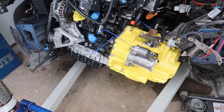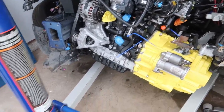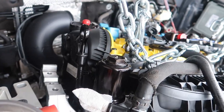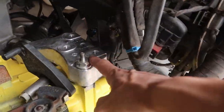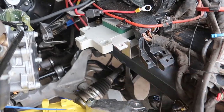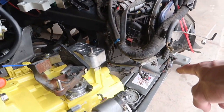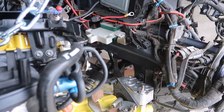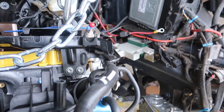This is gonna be interesting to do by myself, but basically she's in there, wants to rotate, whatever. I'm gonna get this mount, because it's gotta be under here. I'm gonna get it under there and give it a couple jacks to try and get this side closer to this, because this is way off. And if not, I'll take the jack on this side and get it up under the trans to help line up the holes. And once they're close enough, I'll drop the bolts in.